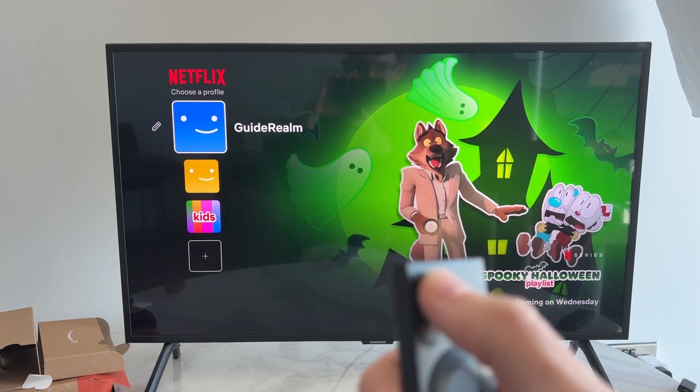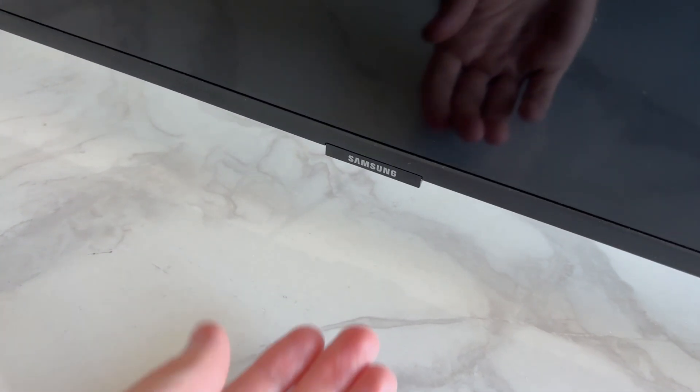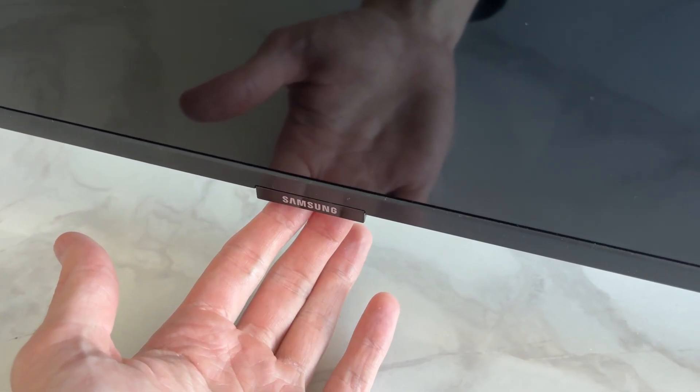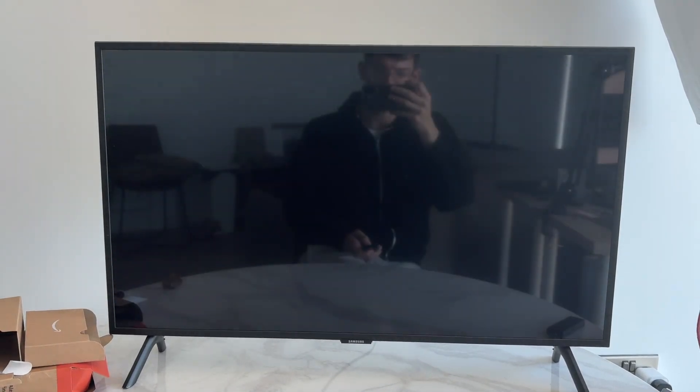If that doesn't solve it, go and turn off the TV. Come to the wall outlet, turn it off and unplug it. Return to the TV and find the power button — in this case it's in the middle underneath, but yours may be to the left, right, or on the back. Tap and hold this for 60 seconds, then release and turn it back on. Come back and try using Netflix to see if the problem is now solved.